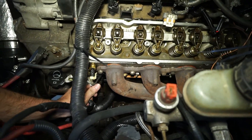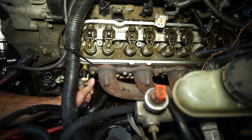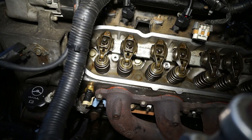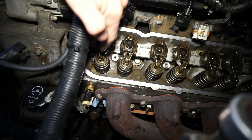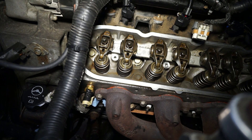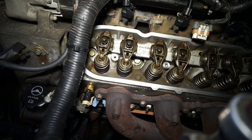I want to be able to put this thing in there — it should go in far enough and it'll actually catch on the tape so it won't fall in and it'll hold it in position. That should be enough just to catch the piston on the way up. First thing I'm going to do is find the compression stroke. I'm going to rotate the crank over. I could do it by watching the intake and exhaust valves, but what I usually like to do is just put a little rag in the spark plug hole and turn it over, because when it gets to the compression stroke and starts to come up, it should pop that rag right out.